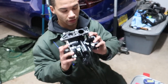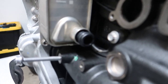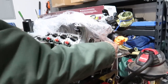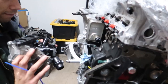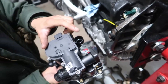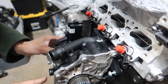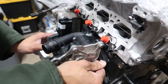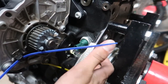All the hardware that connects this to the block stays in there. I'm going to lube up the O-ring at least, slide it on there and lock them all down, then do the center piece and the one for the back. There are two alignment pins for it in the block, and you've got this pipe over here you have to slip in. Trying to get it all lined up and screw it in by hand at least. The crossover pipe kind of messes with the amount of room I have, but I've got room to come through this way still.